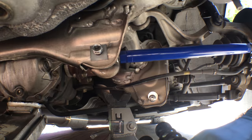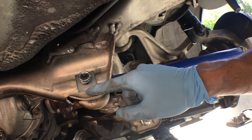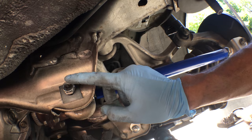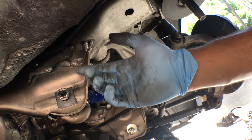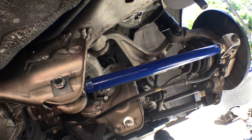What's cool about this kit I got on eBay is that it has a lockout bolt that came with it. That's where you normally would adjust the rear toe on this setup, but they give you this plate and it centers out the bolt, and now you adjust it from here. That's proper — that way it's not gonna spin on you. So let's bolt it down and do the other side.